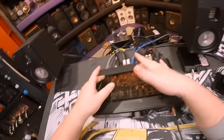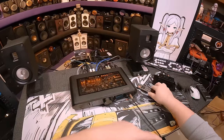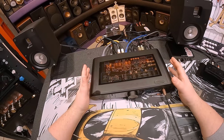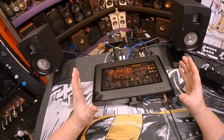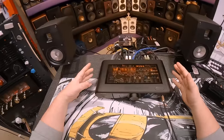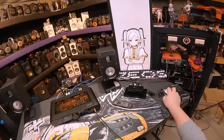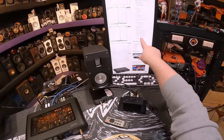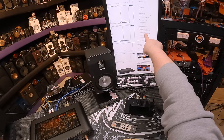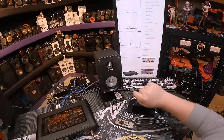You gotta have seven different digital inputs, and I gotta have all the analog outputs, and they gotta be individually controlled, and the volume control gotta control them all, and you gotta have the remote. Holy shit, this has so much going on. If 3 years ago, before I knew this was a thing, you described what this unit can do, just as text, if I didn't know the brand or anything, it's like, how about a unit that has 10 watts at 16 ohms, 7 watts at 32, 4.2 at 64, 1 watt at 300, and 460 milliwatts at 600 ohms.